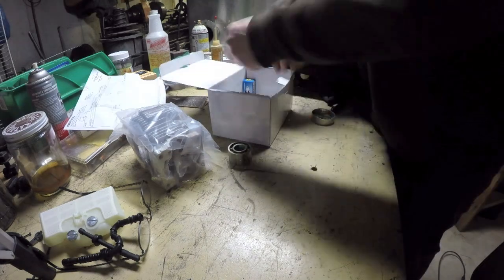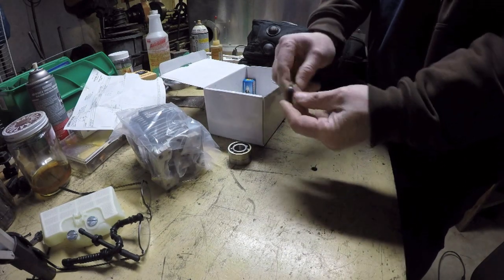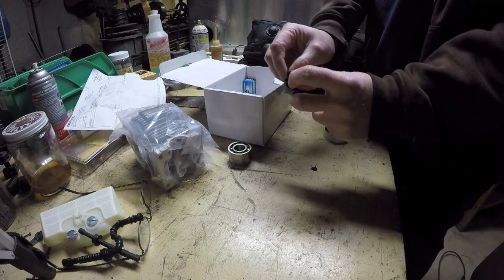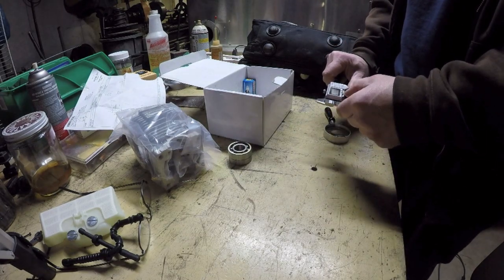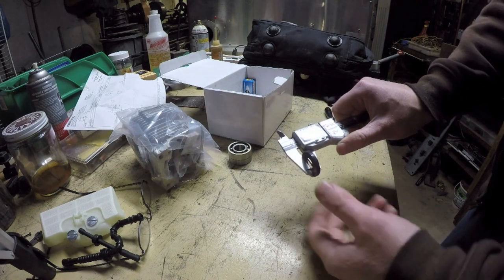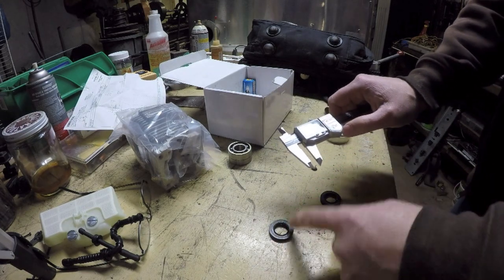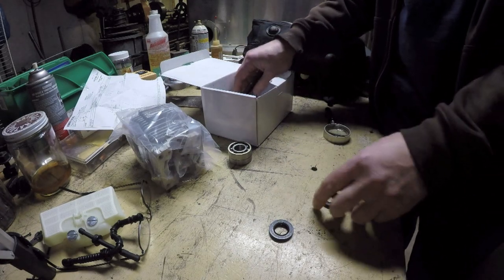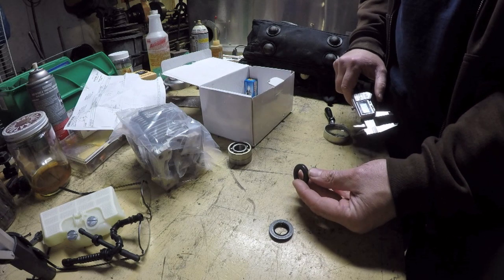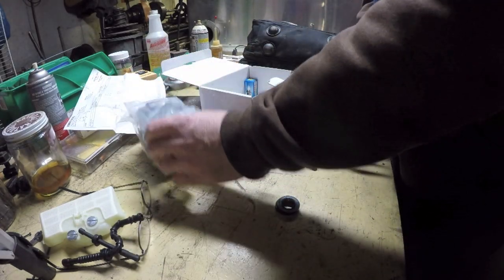Here are the oil seals. These have a number CO141 and some other numbers — I see a 17, a 30, and a 5, so these are 17 by 30 by 5 millimeter seals. These are going to be thicker than the original ones, which is why some people complained about aftermarket kits saying the seals were too big. They're actually measuring out at just under 5mm, whereas the original Stihl ones were 4.4mm, so these will sit just the slightest bit proud of the housing. I doubt that'll pose any problem.